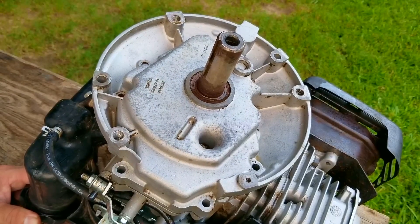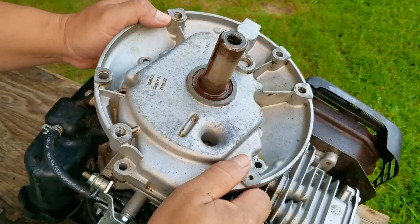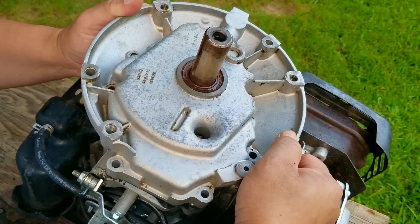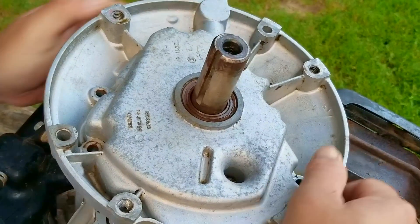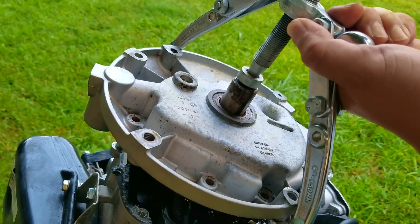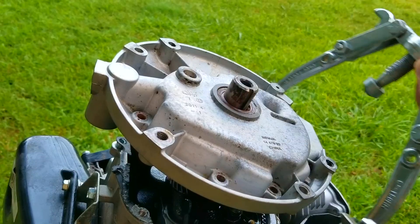Next I want to tap around the sump to help get it loose from the block, but things don't go quite as planned. Once the sump was loose I tried to pull it off the engine but I could only move it so far before it got stuck. I tried for several minutes to separate it but the sump was stuck to the crankshaft, so I got desperate and used the puller to help separate it. To avoid this issue I should have used some sandpaper to clean the shaft of rust from the adapter before trying to pull the sump off.